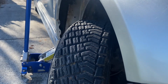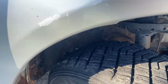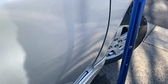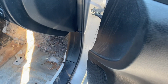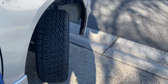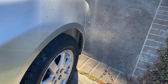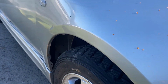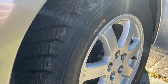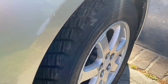I do feel like I'm going to get some interference with the guard under compression because it's going to come up, because I think the tyres were hitting the guards anyway, so I'm probably going to have to roll the guards, but it seems to be fine that way. I'll turn the wheel completely the other way. Okay. So seems like it shouldn't be too bad. Yeah, I don't know. I'll take it for a test drive just with one done, and we'll see how it goes. Okay, so I took it for a test drive and ploughed through a few gutters and curb cuts and stuff, and tried to sort of flex it up as best you can in a Subaru with stock suspension on an embankment, and it didn't look like it was going to hit. So I'm going to try and roll the guards out a bit anyway, but yeah, I'm happy with the fitment, so do the other side.